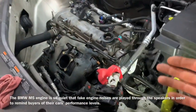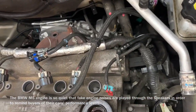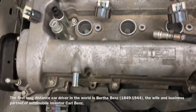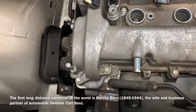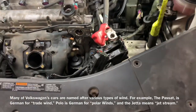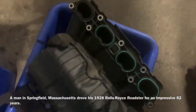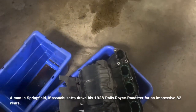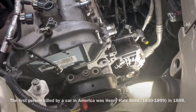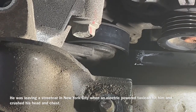Frank tells me this is as far as he's going to go with the top for now. He's not dealing with the coolant yet because when he's working underneath, he doesn't want coolant dripping all over him. So far we've basically done some wiring, disconnected the shield, got the catalytic converter bolts out, and so forth. There are seven bolts that hold down the intake, and once you remove that, we can start removing the serpentine belt off the engine. We are going to remove the AC compressor and the alternator from the engine. Down on the tensioner assembly, you insert your ratchet — three-eighths square — and turn it clockwise to loosen the serpentine belt.